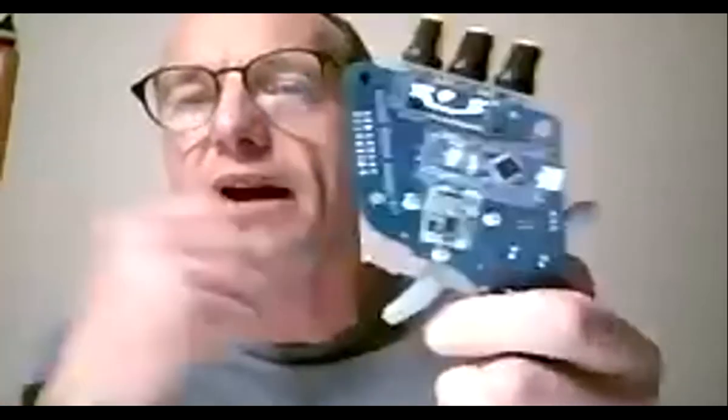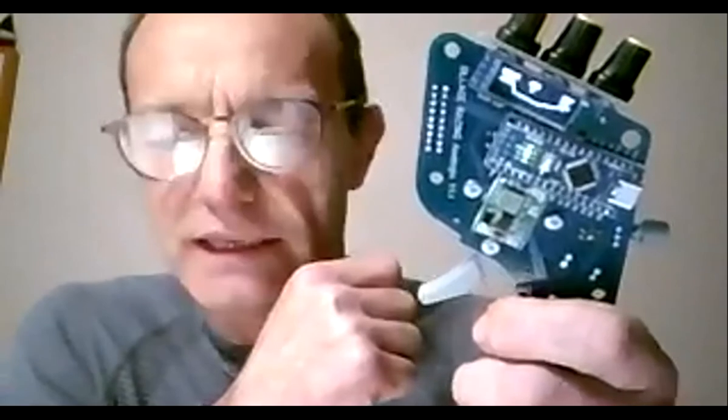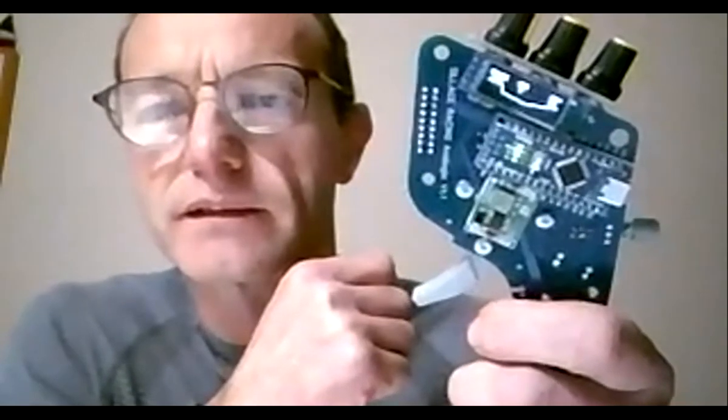That's right. If I can explain how I understand what we're looking at right now, you have this screen that we're seeing. One knob controls how hard the brake is as soon as you let go of the throttle. Second knob controls how quickly the brakes go down to zero braking or stay at zero, with the curve. And the last is controlling the acceleration, how it speeds up when you pull the trigger.